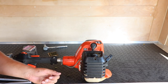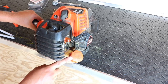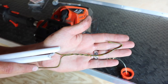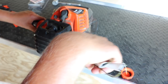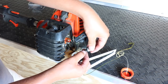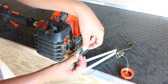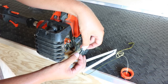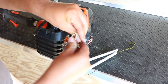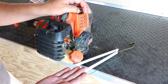Now let's change the fuel filter inside the gas tank. Inside the fuel tank is obviously where the fuel filter lives. You're going to need a wire hanger with a hook on the end — that's the tip and trick I use so you can fish it out. Let's take off the cap entirely. Here's a basic dry cleaner hanger — use it to pull out the fuel filter. First time, voila, not too bad. Now some of these have a little cap or a little spring on the end — you can just take it right out. We've got our new fuel filter, we're going to put it right back into the line. If your fuel line has a clamp or a spring, make sure you slide that back on the fuel filter so we can keep some tension on that fuel line. Let's put our cap back on and voila, the fuel filter is done.